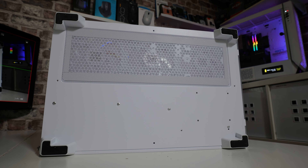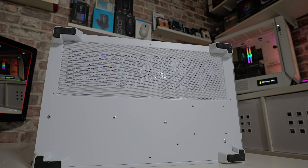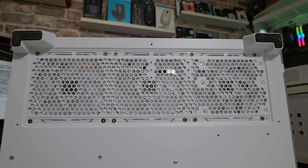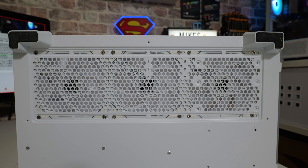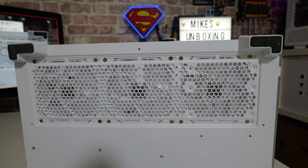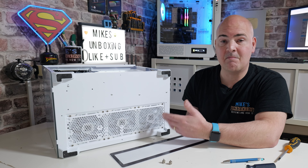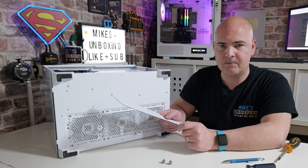Let's take a look at the bottom. We've got some padded feet, raised off the deck — about an inch of clearance to allow fresh air to come in, because this is going to be your primary air intake. This is also filtered. I would probably recommend removing the filter to allow slightly more airflow, as this is one of those old-fashioned metal ones with very tight perforations. We've got the hexagonal mesh there and the fans. Being that they're on the bottom, when they pull in dust, it's actually quite hard for dust to get in, because the dust has to fall down, go across 90 degrees, and then go back up 90 degrees — which is quite a difficult thing for dust to do unless the fans are at highest RPM. So potentially I would suggest leaving the filter off to get better airflow, especially for lower RPMs to make the fans quieter.